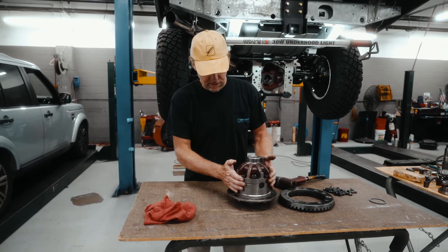Let's get a bit of oil. Not super necessary, because as soon as we lube this, it's going to get oil on the bearing anyway. We'll turn it over by hand before we put any load on it. So all important, oil slinger fits in over there. And now we haven't done this yet, but now we can install our seal on the back. Okay, so just install the seal.